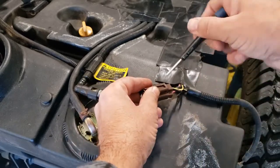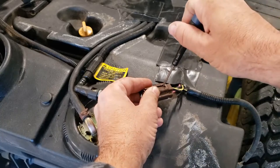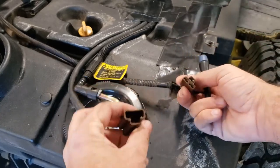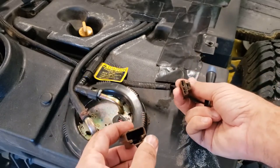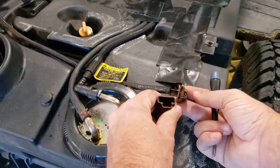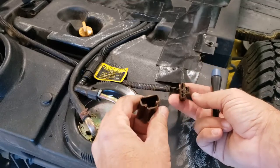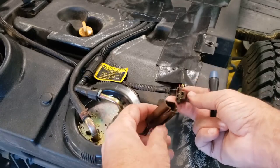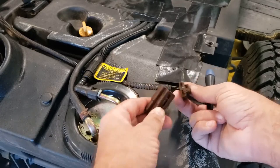On this one there's just a little pin on the male side, so I just took this tiny little screwdriver and pushed down on the pin and that released it. But I'm already seeing there's just a ton of gunk in this connection, so I'll get that cleaned up with some electrical spray and put some dielectric grease on there. That could be part of an issue right there — a poor connection.